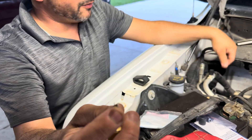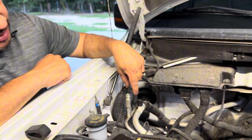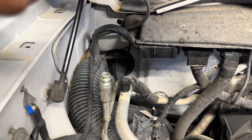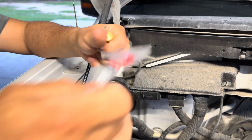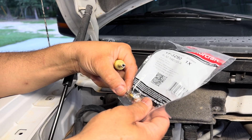But if the high side has gone bad like this one — you can see this green — this is the oil once it's mixed in with the refrigerant. It has been leaking out of here, so that's where my leak has been. I went to O'Reilly and bought the Motorcraft YF3290 Schrader valve that goes in here.